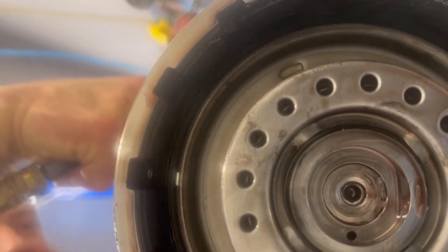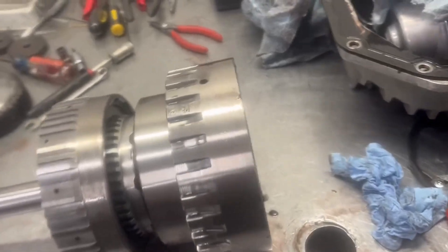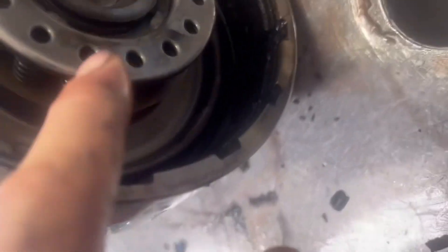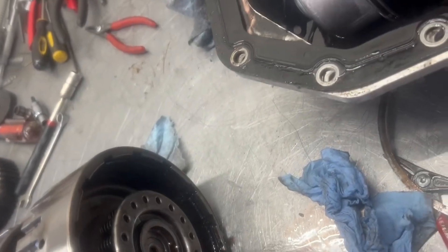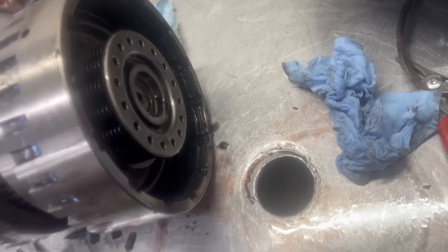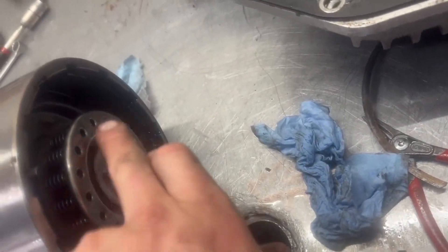I can hear it - you can probably see it. What does that tell me? That tells me the hydraulic circuitry is still intact and working. But we didn't receive the line pressure we needed here to hold this clutch tight. Again, exactly what I said before - a loss of line pressure. I just watched the video because I couldn't see it. You probably noticed a little bit of air leaking around here around the input shaft - we're losing a little bit of air, you can see a little bubbling. That's not uncommon: one, we're not spinning; two, there's no ATF fluid in there to help sealing it. But it applied fairly easily. That's only about 60 psi shop air applying that. We did see a little bit of leaking, but you also did see the piston applying.